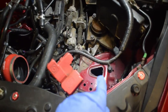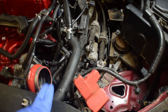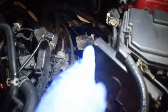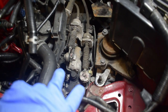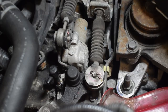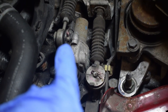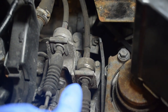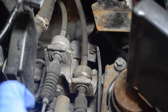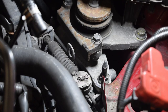Right, so we've got everything out of the way. Battery's out, battery tray as well. We took the intake out up to the throttle body and left that there, and the bracket for the heat shield as well — taking that out just to get full access. These are your shifter cables which I haven't taken off before. We're looking at it and there's a pin here and a pin here that needs removing, and then you've got these two sliding pins here that are on these brackets, so they'll need to come out of there so we can release the cables.